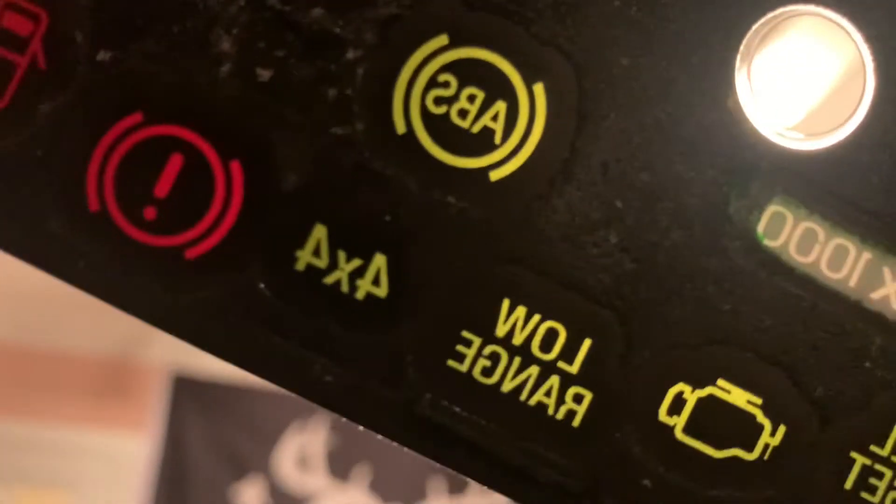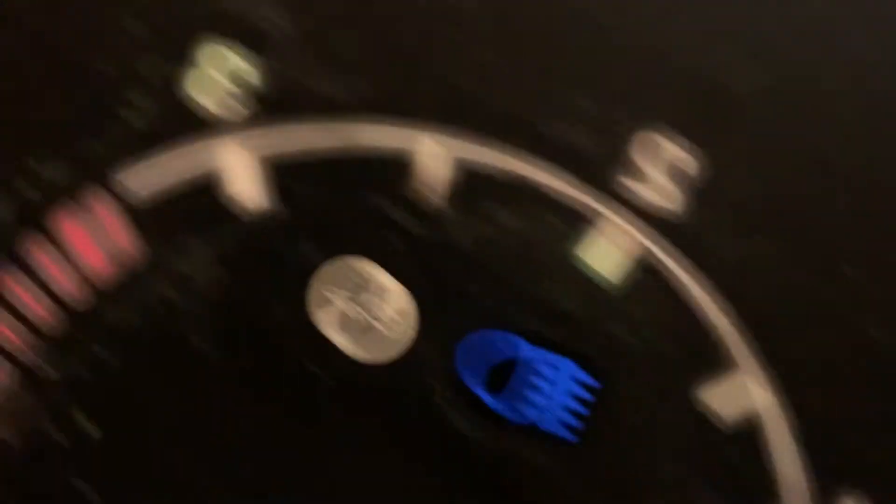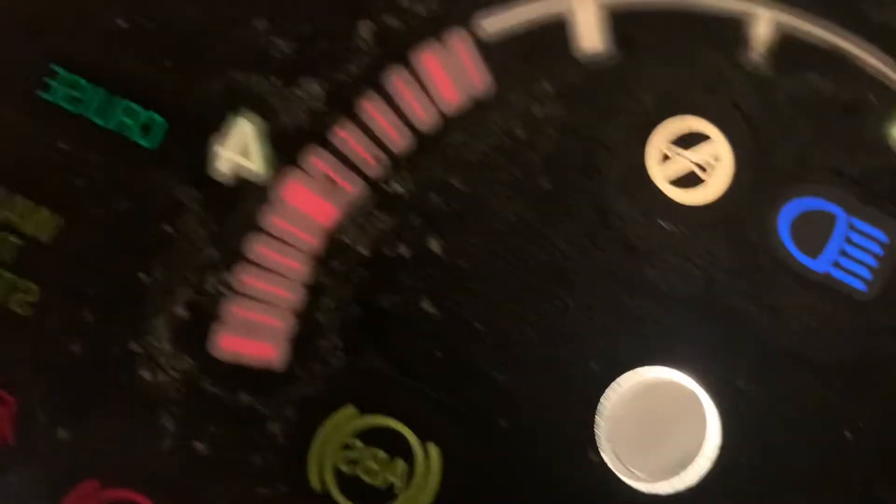Basically I'm gonna show you something. You're gonna look into the light here — as you can see it's got that green tint. That is what all these look like, but now they're white because I scraped them away. Even your wait-to-start light is the color that it will be. So if you want to change the wait-to-start, scrape that one away too.